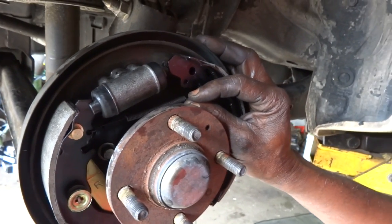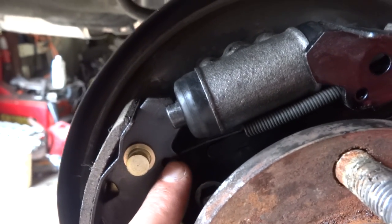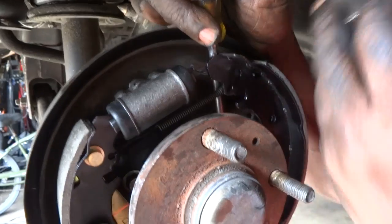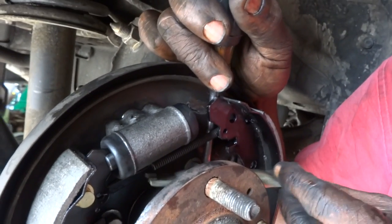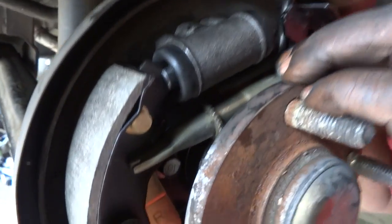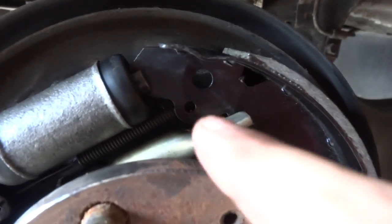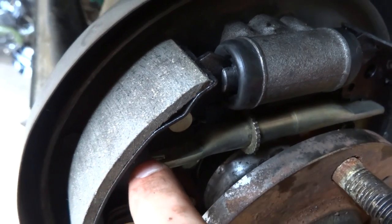On the left side where the e-brake arm is, you're going to put the back spring right here on this first one. On the other side where there's no e-brake arm, it's going to go all the way to the far back one — so it goes behind it. Now we're going to pull it back and stretch it. Next, we're going to put the adjustment arm in there. Watch how this goes in because it's crucial you get this right — you've got to have one of the teeth sticking out because we still have to put the other lever in there. So it goes in just like that, and you get the big part sticking out. Where the e-brake control arm is, you have one little tooth sticking out for adjustment.